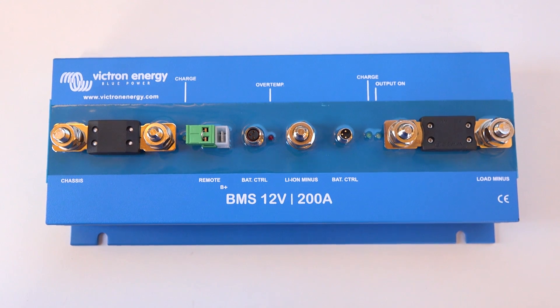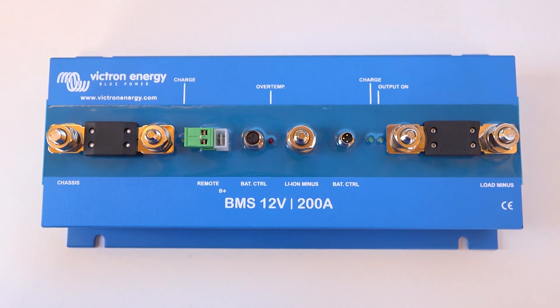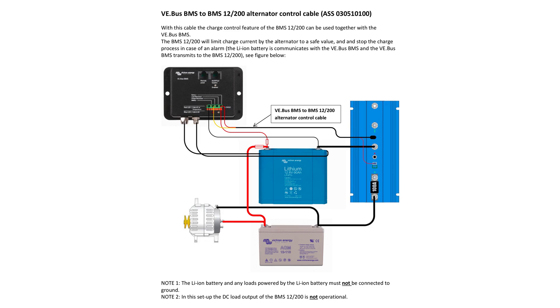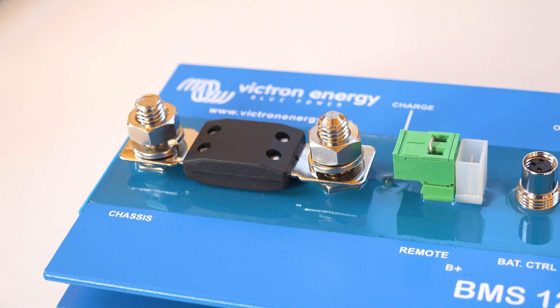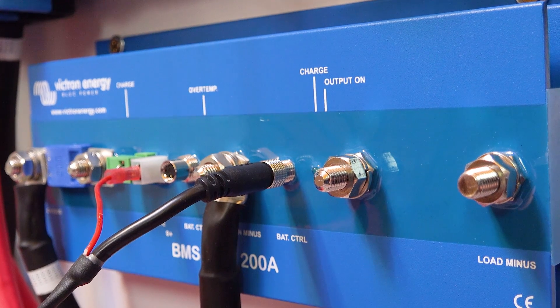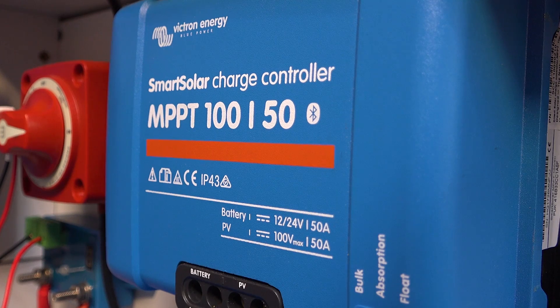After a lot of testing I've decided to use a Victron BMS 12200. It's normally used as a battery management system, but after a bit of digging I discovered a PDF document. With the use of the alternator control cable, it ignores the battery management system part of the unit and instead performs two key functions I was looking for. I can regulate the charge current from the alternator with the value of a mega fuse — the charge value is around 80% of the fuse's value, and I can go as low as 40 amps and as high as 200 amps. I can also use the BMS 12200 to cut the alternator charge source, just like the battery protect can for the solar MPPT controller.